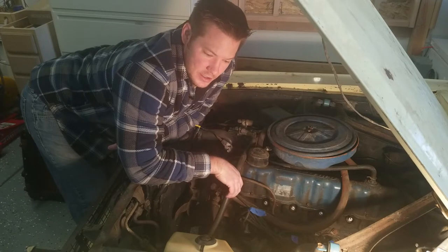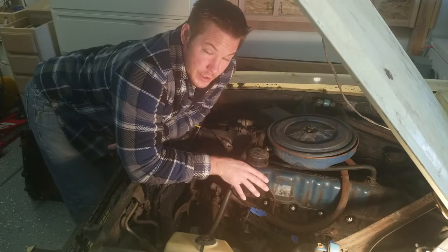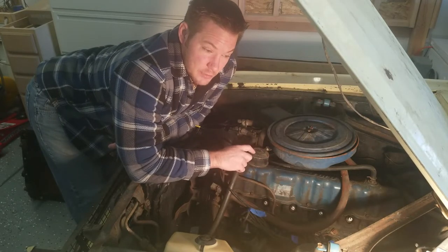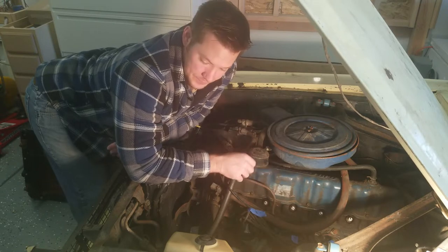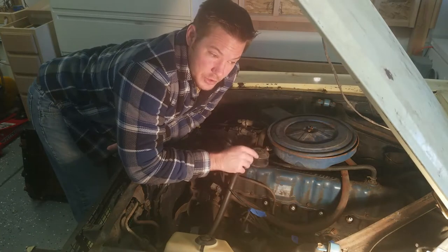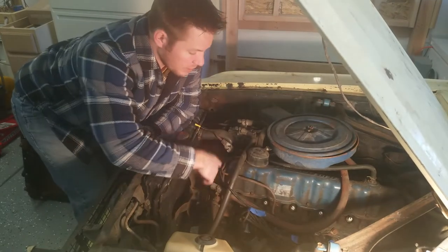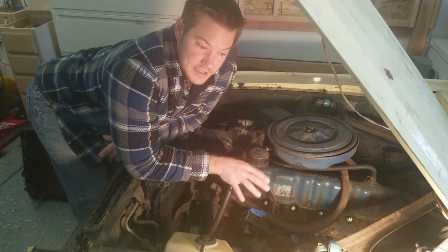What's important right now is unseizing the engine. When you're storing an engine or a car for long-term durations, obviously you don't want to drain the oil. Putting fresh oil in there is a good idea, but don't drain the oil because you don't want moisture to get onto the components inside your engine — they will become susceptible to moisture rust, which is rust that occurs from the moisture in the ambient atmosphere. That's largely what's all over this car: surface rust from ambient moisture from being in a barn for 33 years. If you have the ability to occasionally go in and turn the crank and allow that oil to get pumped back through and keep moving, that'll help keep parts lubricated.